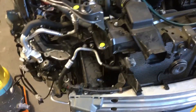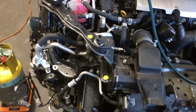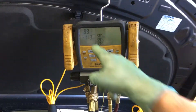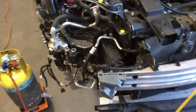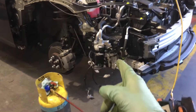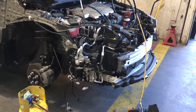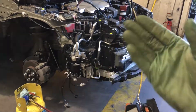If you expose them to the atmosphere, that's about it so far. I'll let you know what I get out of here. I've got to go get a heat gun and heat this up so I don't have to be here one, two, or three hours. I'm down to 900 microns, but by that frost level I still know I have several ounces of refrigerant in there. Prius Prime potential leak spots — you're going to have to keep an eye out on them to see what they turn into over a period of time as we start seeing more Prius Primes.